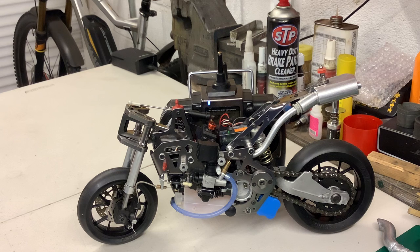With that exhaust it sounds really really nice — not loud but really responsive on the throttle, I couldn't believe how responsive it was. I've not had it change gear yet; I noticed the screw's out quite a long way and I don't want to scream it on the starter to force a gear change. I'm going to take it to where I usually run it and tune the engine there — it's best to sort the gearbox shifting and mixture when it's actually running rather than just sitting revving. They get hot. I'm trying not to run a cooling fan to keep this a very lightweight, simple build.